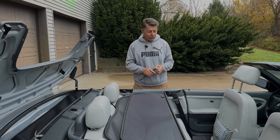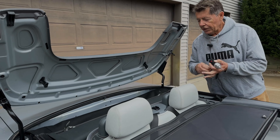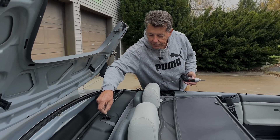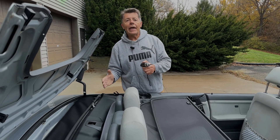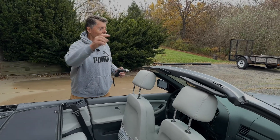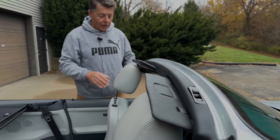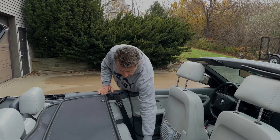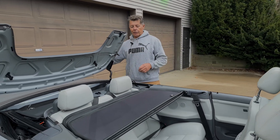This is only needed for the third motor. There's another third motor in here that you would stick this Allen head wrench into and turn it — or I'm going to use this electric screwdriver. This is something you do at the very end to engage the latches into the windshield header. So that's the last step. To repeat: first step is to pull this strap, disengage both motors which are in the trunk by the left fender.